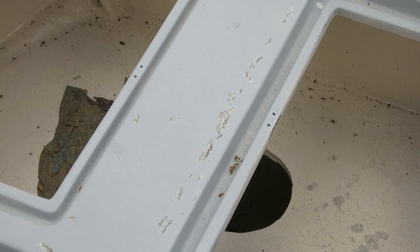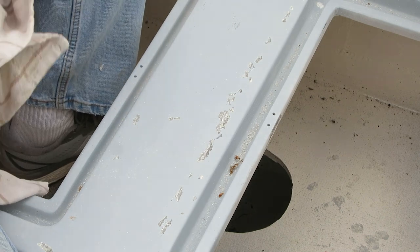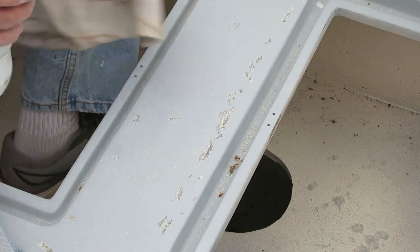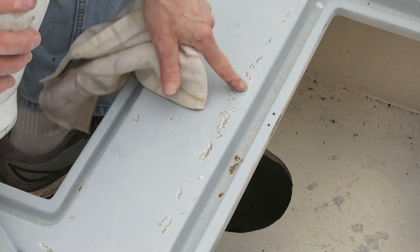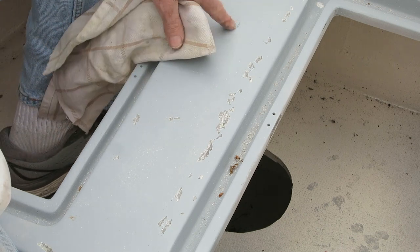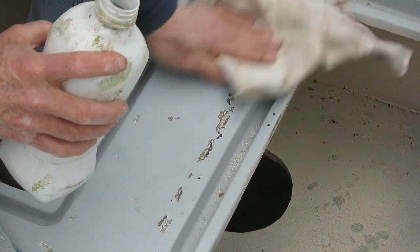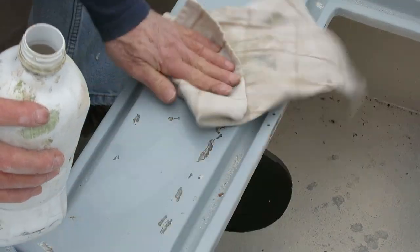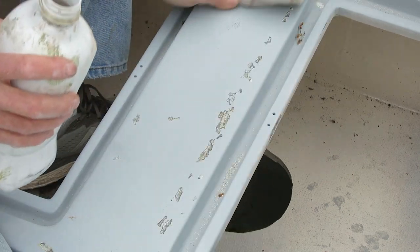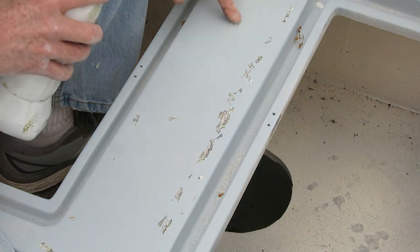We're a little bit backwards today. I've given my gray primer a good sanding and everywhere I found a little imperfection or defect, I went and took it out with a pencil grinder — a little Dremel tool — because I just wasn't comfortable laying on that epoxy filler in real thin coats over areas that might not be good. If I'm going to put stuff on there and have to re-sand, might as well give it a little depth because it really won't take any more time. Getting ready to do another skim coat — it's warm today — and then we'll sand and see where we stand.